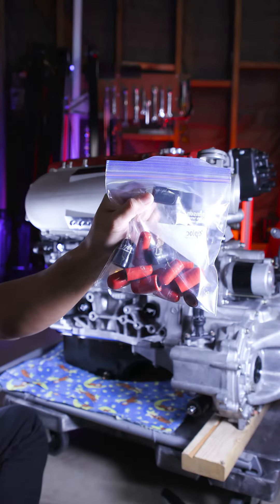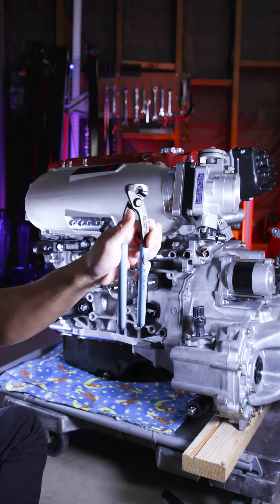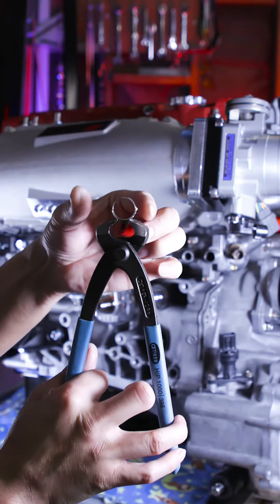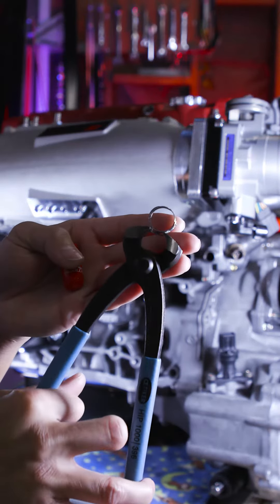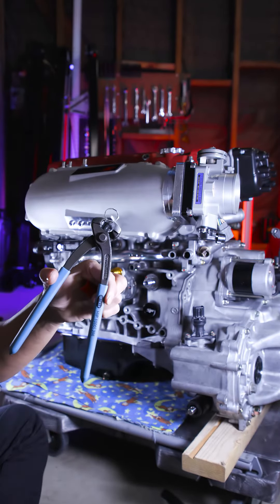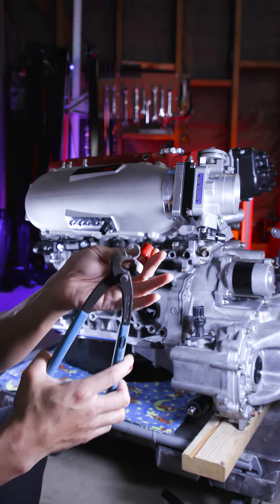They come in different sizes, so if you guys need a certain size you can go on the website. We're going to be using a different type of clamp. I forgot what these clamps are called, but they're very popular on Euro cars like my Porsche. What you do is just crush these corners and they're pretty much permanent — you really can't remove them without destroying the clamps. I like these better than worm clamps. I got worm clamps as well, but I'm going with this style because it's cleaner and there's less room for air with the clamping.